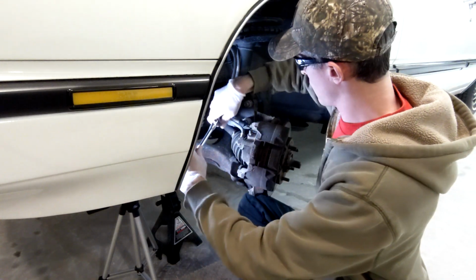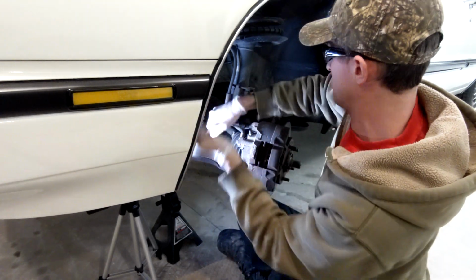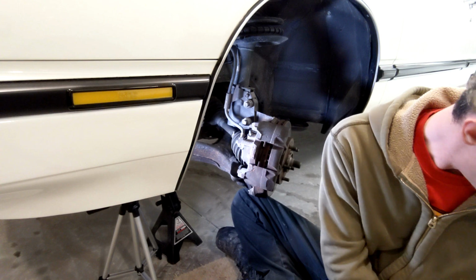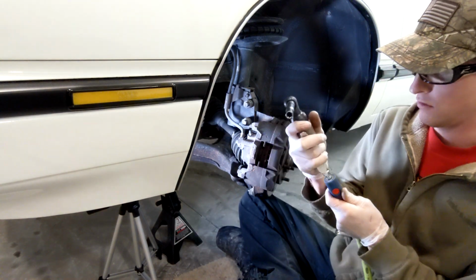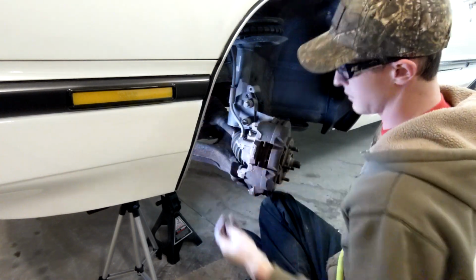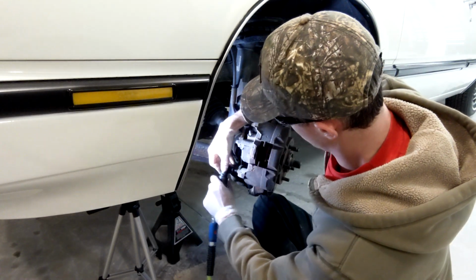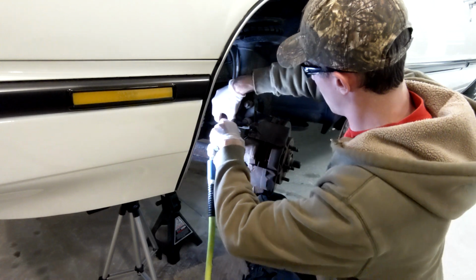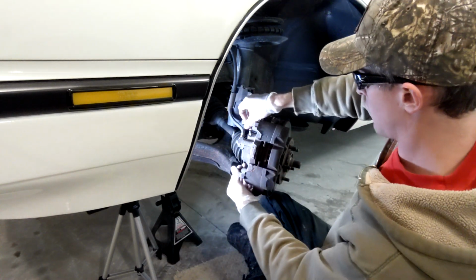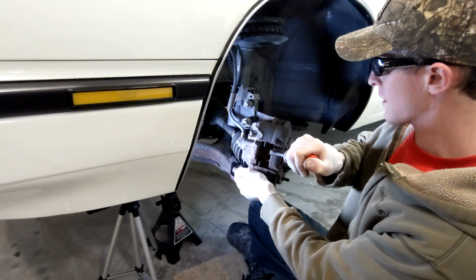I'm also going to take the brake line loose. I think it makes for a little better access. Oh boy, there we go. Perfect. So next up, we'll zip that 10 mil off. For that, I'm just going to use my air ratchet. That guy's out. Just kind of set the bolt somewhere where we'll lose it later. Take this guy out. Sweet. Okay. Next step. Just gonna get in here with a screwdriver and retract that piston just a little bit.